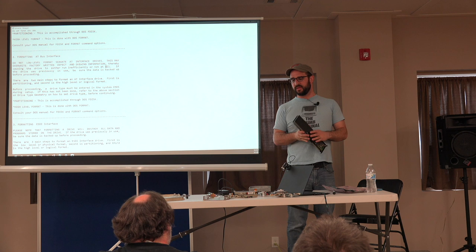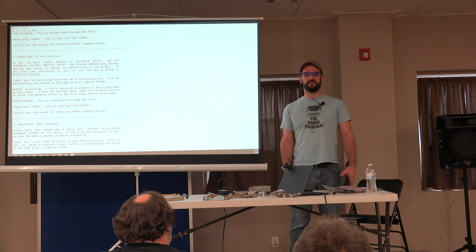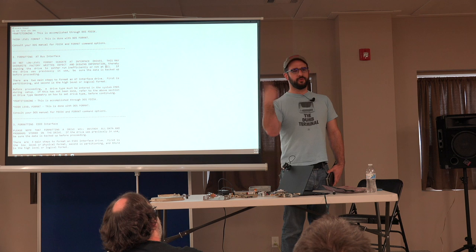On these MiniScribe drives, if you don't want to unmount it and you're just being lazy, you can just poke at the little interposer on the side. Probably not the best idea, because you're now moving the... Oh, so that's another important thing. These drives don't auto-park. A lot of these early stepper motor drives don't auto-park. So whenever you turn the disk off, that's where the head lands. Oops, it was in the middle of your data. And now you do that 10 times and you've worn the surface off the disk.